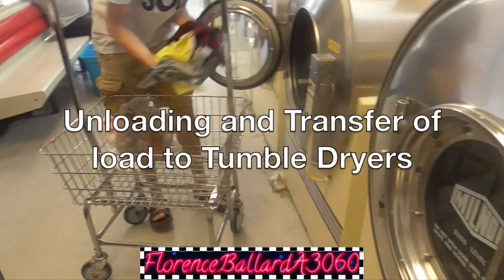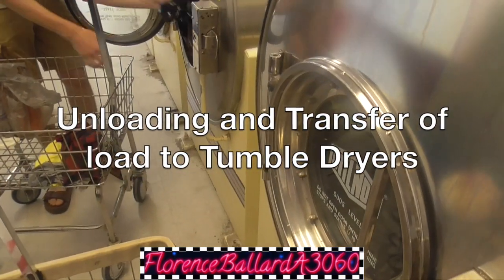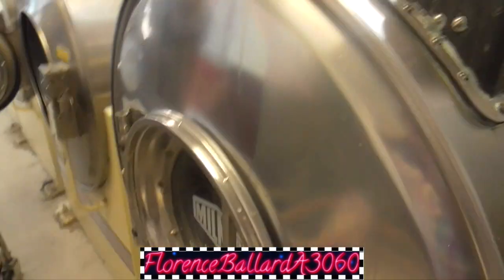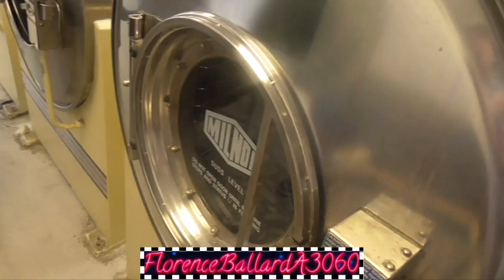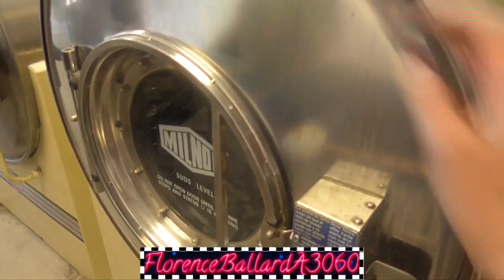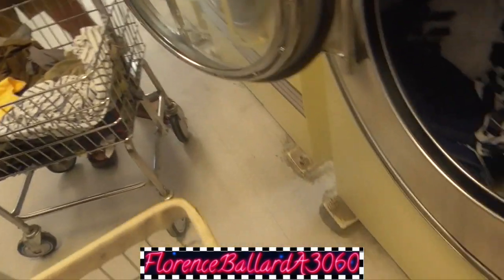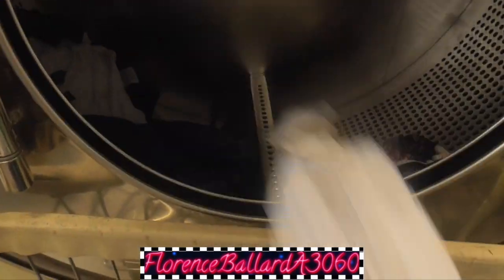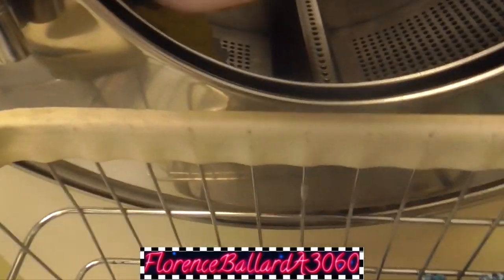Anthony's unloading his. How dry are they? They're very wet. It's because it's quite a slow spin, really. If anything, a domestic machine has a faster spin. Front loaders do. See, I could have won this yesterday. In fact, most average top loaders spin at about 600 RPM. Actually, not too bad. They're quite dry for the G forces.